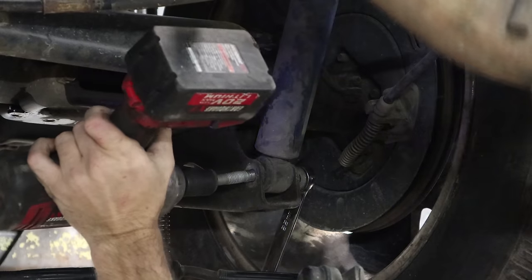Put our spring back in for the second time. This is pretty much all the stuff that we did on the trailer to make it drivable — I had to kind of do it again. Pull the shock back up. Put our arm back in there — kind of pry the rear end to the side to get the bolts lined up, also easier with two people. Now we can bolt our exhaust to our crossover pipe.